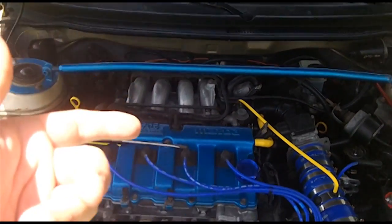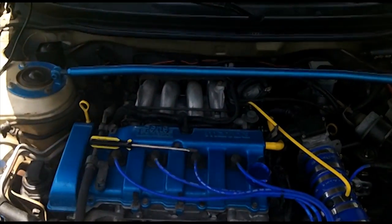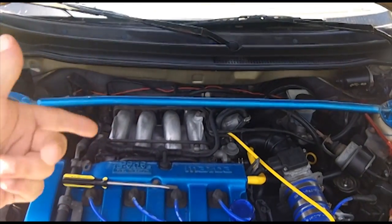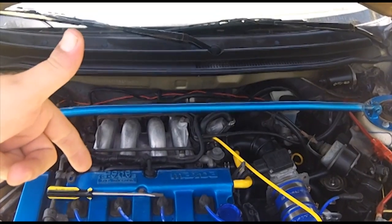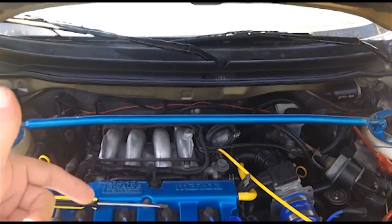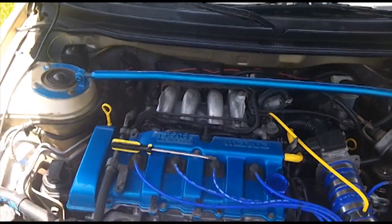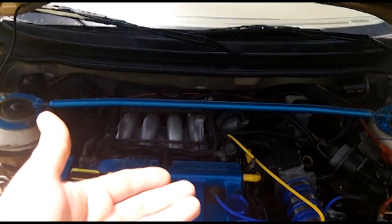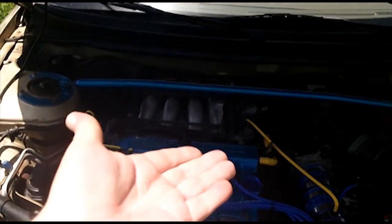Will also be handy for just about anyone that owns a car that has a Purge or Evap system. It's not going to be exactly the same. The Purge solenoid might have a different switch mechanism. It might be off all the time, and when fed 12 volts it might switch on. Or it might be on all the time, and when fed 12 volts it might switch off. So there's two different systems there. And you can check out Scanner Danner's video, which was awesome, and that video is right here.